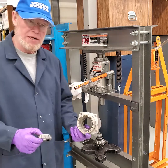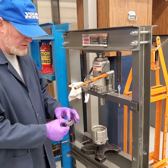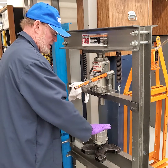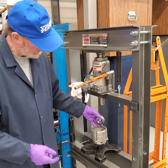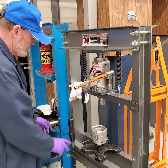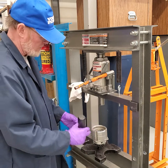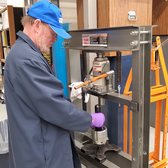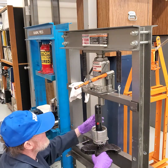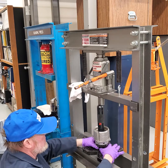I'm going to take the carrier — it already has the races pressed in it — with the face inward, since obviously the gear goes inside. I'm also going to take a little bit of gear lube and put it on the inside and on the gear before pressing that on. I'll put the bearing inside, line it up with my fingers, then use tool 884-263 — the same tool we used to press the seal out — placed on the bearing itself. Center everything up on the press.